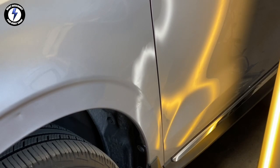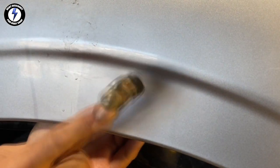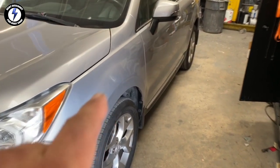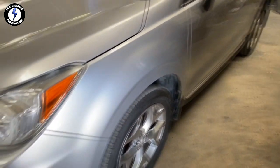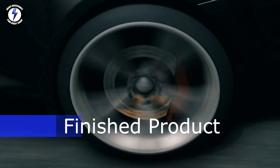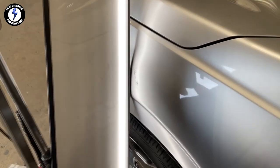You can see the entire fender was affected. I'm taking the blending hammer and cold glue to the edges, and using the hammer-on-dolly on the sharper ding. The customer did not want to replace, repaint, and blend — you can see there's paint damage throughout the vehicle, so it didn't make sense to paint the fender. Instead, he wanted the dent removed only. Here is the finished product — the before and the after.